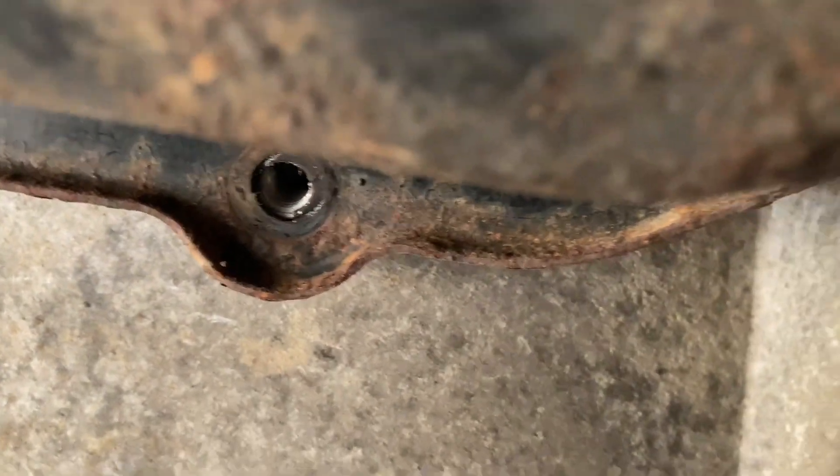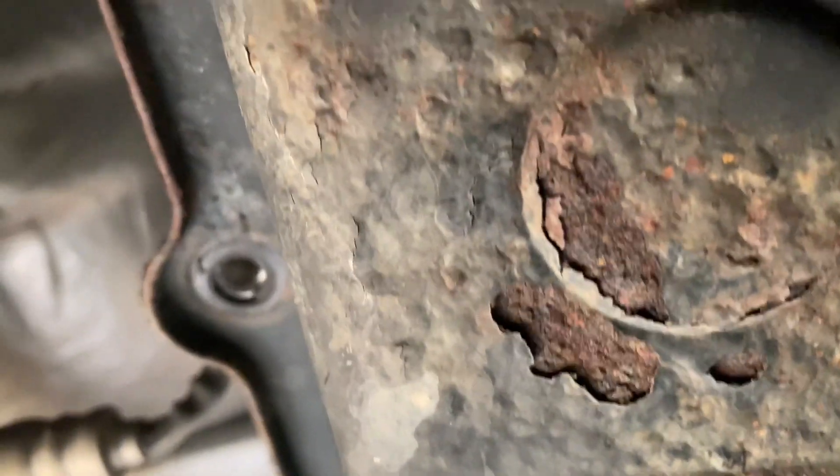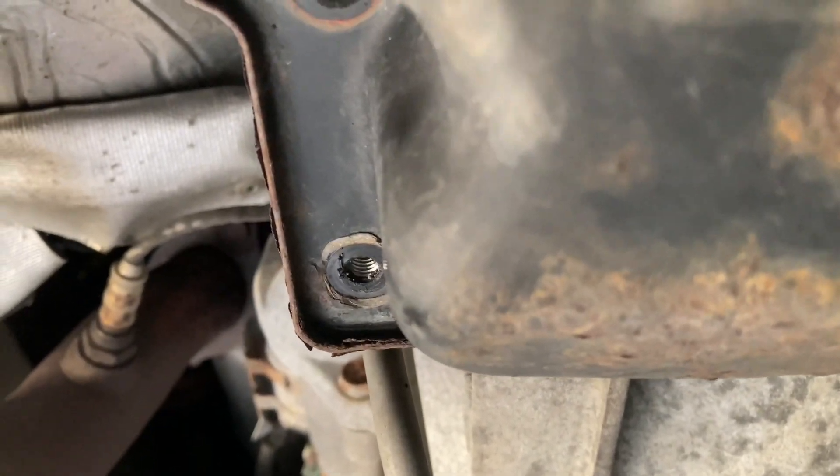Going around this thing, all the bolt holes should be out of it. It's looking gnarly — it's hard to see because it's kind of dark underneath this car, but everything is out of it. We're going to get something to just briefly pry on it gently and try to break the seal on one of these corners to get it to drain. Basically I took my hammer and just kind of pried a little bit on it, and the whole thing popped.